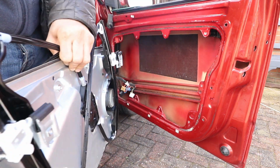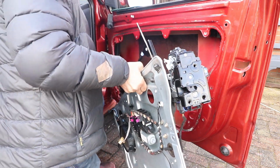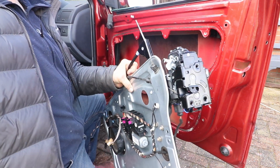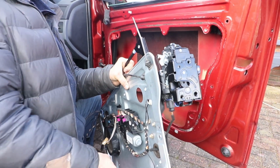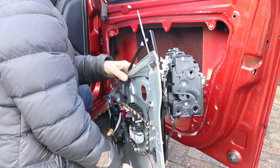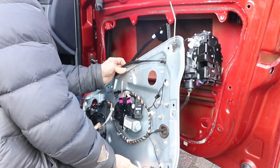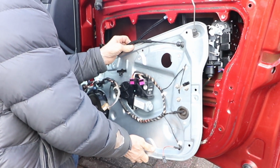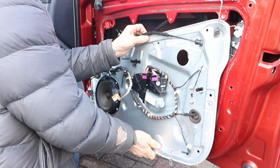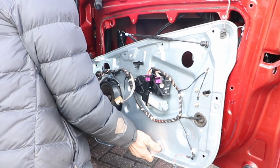And then of course you've got to get the wiring loom through the A-pillar bit on the door, but you can't do that first. You need to put the panel in like this, lower the left hand side down, and then insert the lock and the window winding bracket in first. And then it'll slot up a little bit, and then you can get the wiring loom in place.